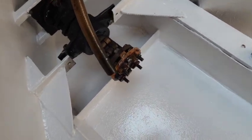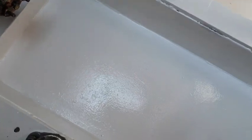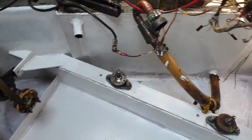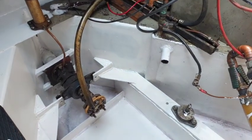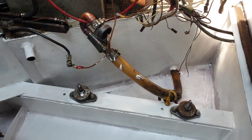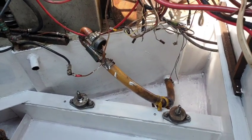All second coated up. Still a few dodgy bits here and there but I'll get them tomorrow with another flash coat — just a light one. I'm not going to stand in it because it all started peeling off and I ended up treading it through the boat. A few bits over in that bit look a bit bluey coloured — I treated them with a rust treatment, maybe it didn't dry enough or reacted with the oil left in there. I did degrease it best I could but you never know. I've also got to take that pipe off — they dropped a bit of crap in the end of there.